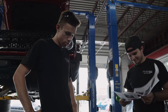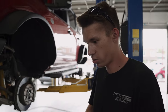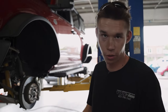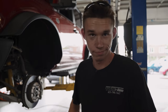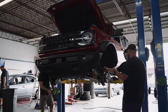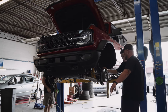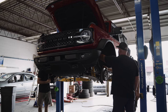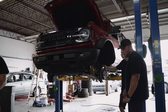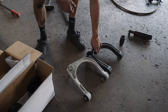Since it's the Sasquatch, I think they come factory about two inches higher than the normal Broncos do, so I'd say this one will put it up maybe to four or four and a half, maybe five inches — hopefully, we'll see. It comes with a diff drop and all that because it's got different axles. It has a factory lift, so you don't have to drop it. It does have spacers — pre-load spacers — so you gotta break the strut apart, swap the ball joint, all that standard stuff. Definitely a lot beefier.